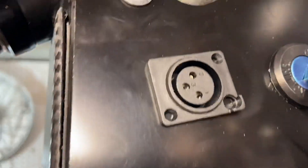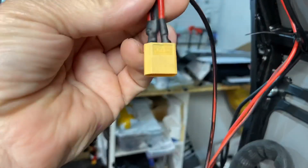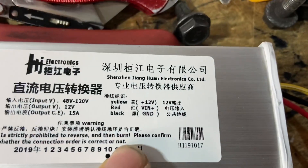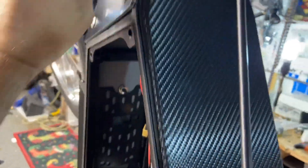Now your ground wire. I have a charger port — see the charger port up there. My charger port and my battery also has this extra wire on the ground, and that's going to go to my DC supply here. Off the DC supply, the black is going to be shared for all the ground wires — for your lights, your battery — it's all shared. The yellow is going to be for your 12-volt supply for lights or anything else you want to run. The beautiful thing is when you turn the key, your power is on and your 12-volt supply is now on.